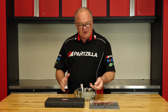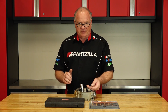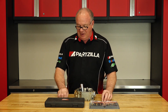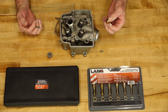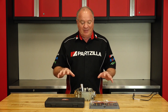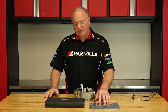It is going to do the minimal amount of damage to the threads while cleaning them up and correcting a small imperfection if it just had a small little ding on the outside of it. Whereas a tap, it's going to get the job done, but it's going to take out more material than necessary, especially compared to a thread chaser. And that's the biggest differences I know and have experienced between a tap and die set and a thread restore kit.